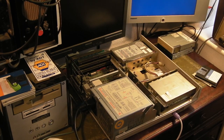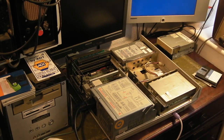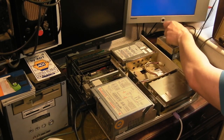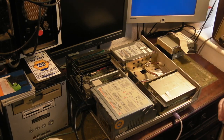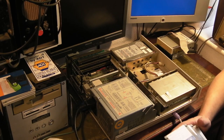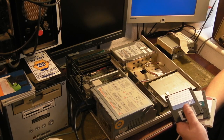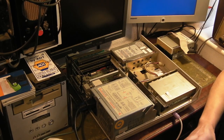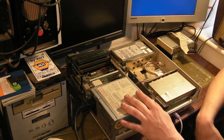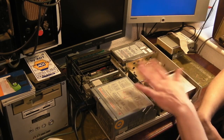I've also got a spare floppy disk connector which might make life a little bit easier because the one on there is keyed. I think it will fit that drive — it will fit the other drive alright because I modified it. Someone did comment after I made the first video that because the CMOS battery is flat, a lot of computers would default to a 1.2 meg floppy drive as the default drive, and obviously this is a 1.44 meg drive. I don't think that'll be the case in this situation because these Apricots weren't really intended to run with a 5.25 inch disc drive.